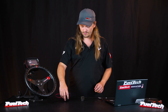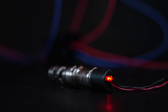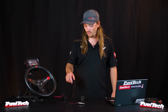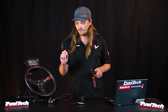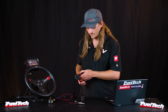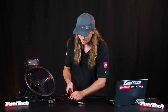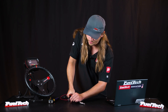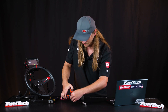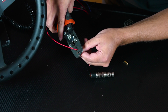Just for demonstration today, we're going to use one of our bullet valves from the dual valve boost controller. This obviously isn't a trans brake solenoid, but it does light up, makes sound, and we had one laying around. We'll use the open power wire on this relay — that's going to go to the trans brake — and we're using splice connectors today just to make it quick and easy for the video. This is not the normal way you would wire this in a car. Anything on a race car should have a connector — you never want to hardwire anything in case you have to service the car or replace a part.